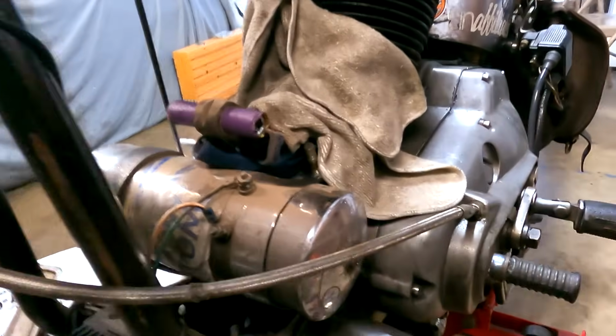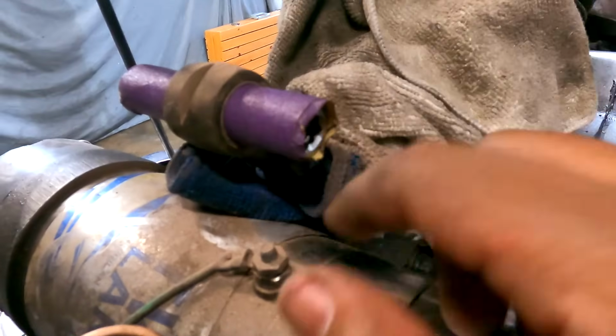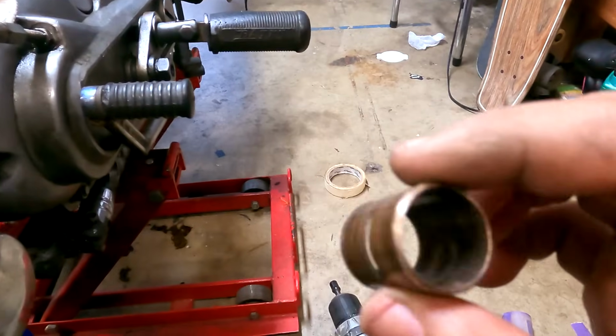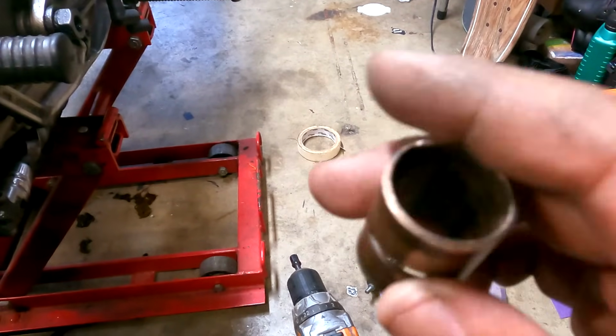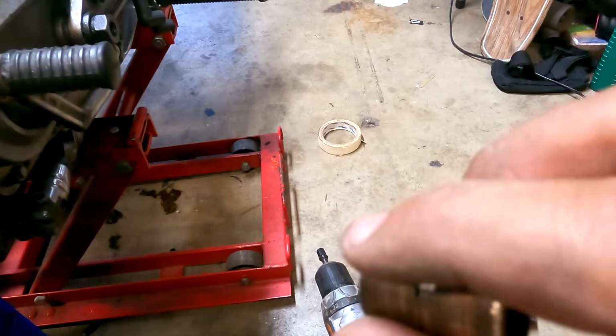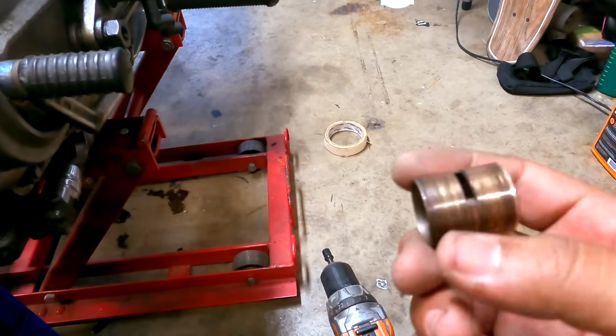Alright guys, so what you're watching right now, it's a little sloppy while the guys are over there talking. I am sizing out the piston ring lock, because the original one, like we already disclaimed, it moved a lot, and that's why the slot wasn't in place, so the piston wasn't getting cooled with any oil at all, which is probably what led it to heating up and blowing up.